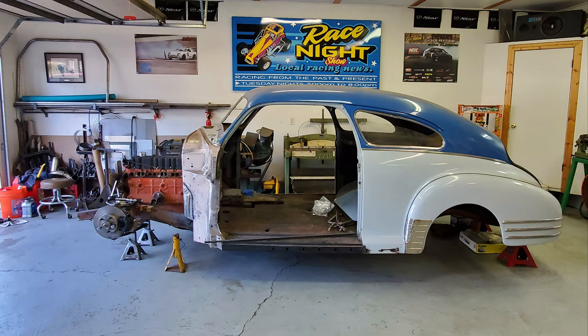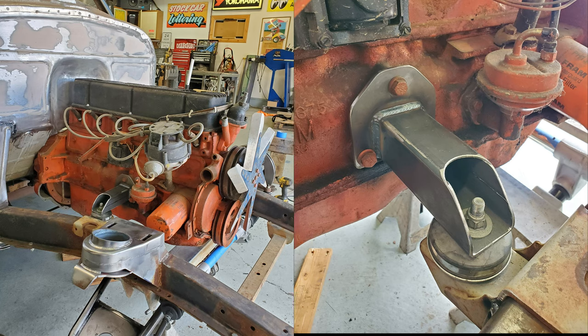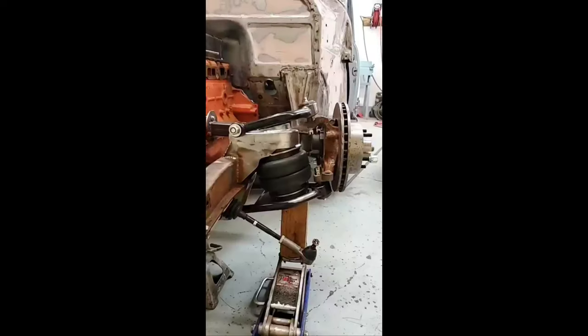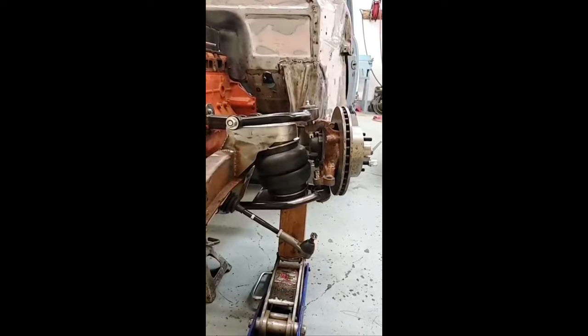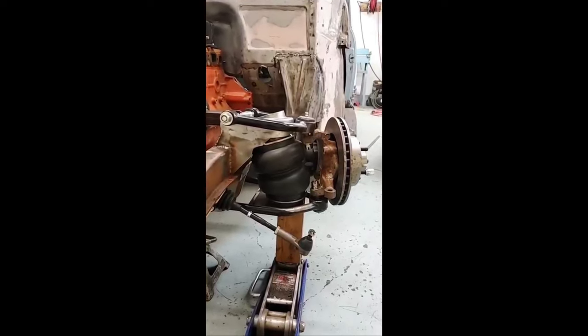After that fiasco, I got to work mounting the setup in the car. I chopped up the body to fit the transmission as I went and made the engine mounts out of some square stock. It was all pretty easy and went very smooth. I mounted the engine as low as I could and as far back as I could — I guess the race car builder in me is still alive and well. During that time my airbags came in, and I got those on under the shock tower and lower control arm up front. Put the Artillery wheels on and checked the travel — as you can see here, I have plenty.